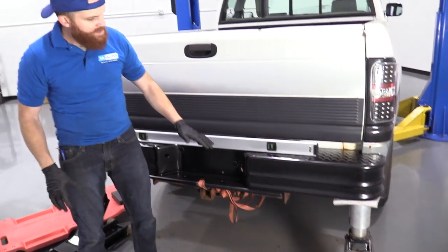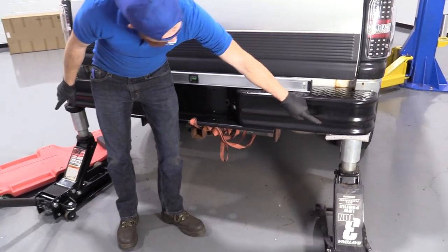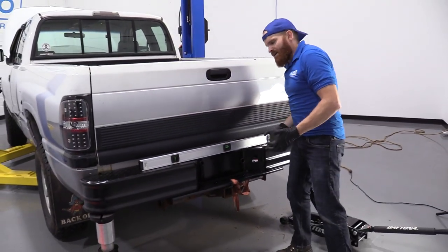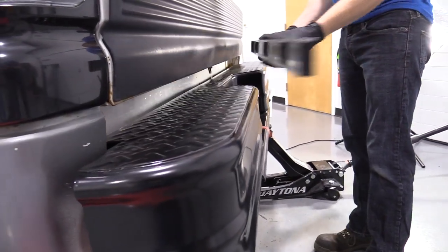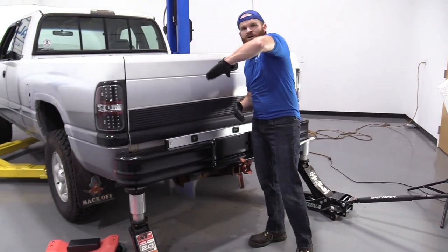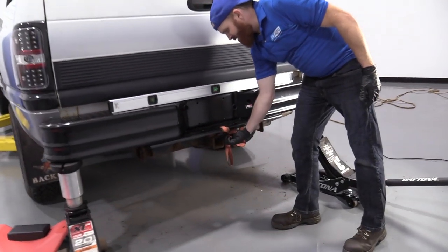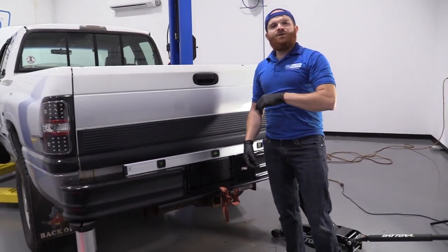So what we did here is tried to level out the bumper as much as we can. We're on a flat, even surface with the vehicle — we're inside our studio. We got the bumper jacked up over here and over there until we're right in the middle of the area for the level. That looks really good. The last thing to think about is the fact it needs to be pushed in as far as it can go, and also the canter of the bumper front to back. We just kind of eyeballed it. If you have a level and want to go front to back as well, feel free. Once you have it where you like it, go ahead and tie it if you can — we just used something as simple as a ratchet strap to hold it in there.